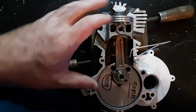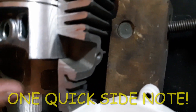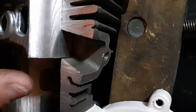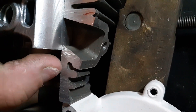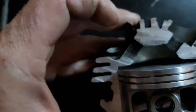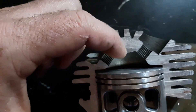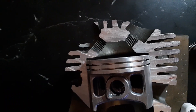With all that said, let's toss a timing wheel on it and I'll show you the timing. That's 0.6 millimeters right there from the top, and as you can see that piston is no longer sealing the exhaust port. You really want at least about 2 millimeters to cover it, otherwise you're going to have a leakage problem. These are actually supposed to be spaced about 1.6 millimeters. You can buy a pop-up piston to fill that volume and that is how people make these higher compression — but you don't want to change this value because it's going to cause a bad day.